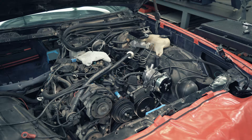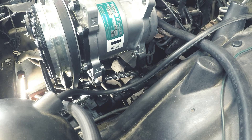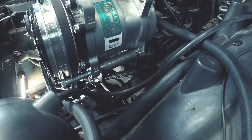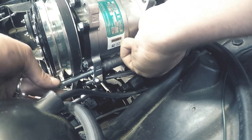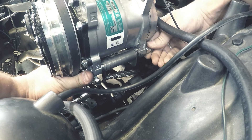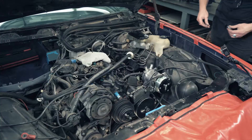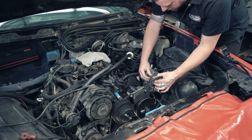That'll just sit in the cradle like that until we get it bolted in. We're going to come around to the side of the compressor and install the compressor to the lower ears using our five-inch bolt, our two-and-five-eighths spacer, and a 0.15 spacer. The small spacer goes between the bracket and the rear compressor ear, then we'll secure it with our nylock — leaving it loose enough that it'll still swivel. Then install the one-and-a-quarter bolt into the top compressor ear with a serrated flange nut on the back, which is what we'll use to tighten this down as we tension it.